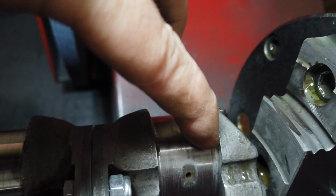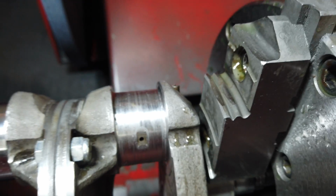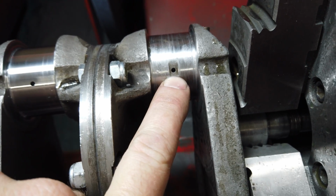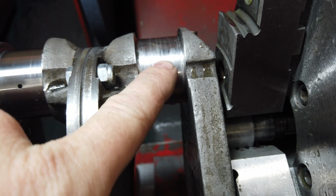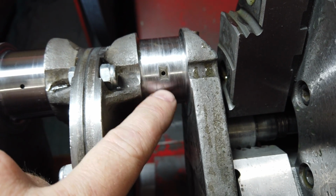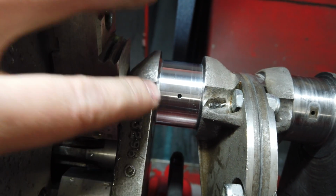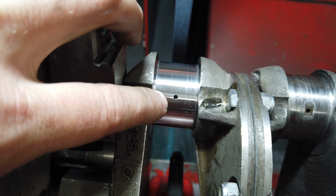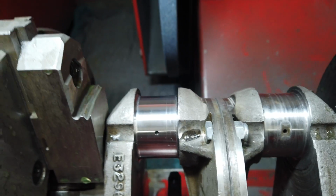It's not proper. I could get a gauge on it and see, but you can just tell it's a lazy radius. The other thing was, these earlier style have more of a cut, I guess, and less of a ground out hole for the oil relief. And then I obviously have made it worse, but whoever had ground it to the 20 didn't go back and clean those up. So there was non-existent on that side, I think.